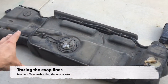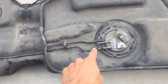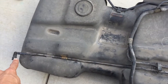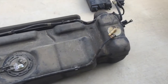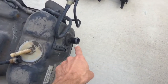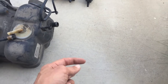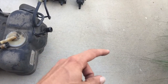Let me explain how all these lines work. They all tie into the EVAP system, with the exception of one line that runs straight — that's the one that runs the fuel to the engine. The fuel pump is actually pumping the fuel. All the rest of these lines are just air lines that are part of the EVAP system. Somewhere over here is where you put fuel into the tank — it's got a big pipe that connects to this big opening here. And then there's a smaller tube that connects here and runs up along that pipe, connecting near where the gas pump nozzle goes in.